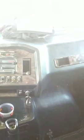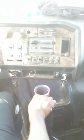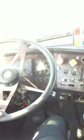Okay, after removing the chock, get back in, take your time, 3 points of contact. Safe start. Okay, now at this time, go ahead and do the brake test. I'm going to check the parking brakes first. Put it in first gear, or you can put it in the low gear.